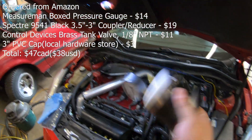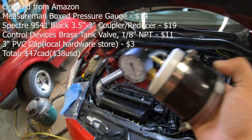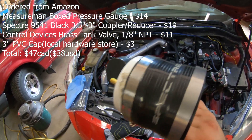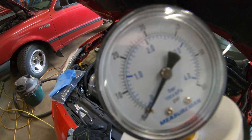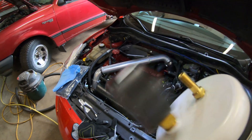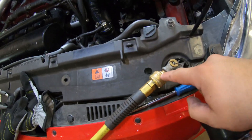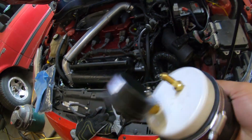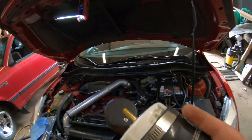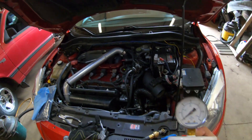I have my own homemade boost leak tester. I'll put the parts list in the description. This cost about $30 to make. It's a 3-inch to 3.5-inch coupler — a cheapy off Amazon for about $15. The gauge is a standard boost gauge, nothing special, about $10 off Amazon, and it seems accurate. Then there's a Schrader valve — you can also use a compressor fitting that goes direct to the compressor line, which would be better, but I went with the Schrader valve. It's more annoying because you have to hold the piece on while filling it with air, but it still works. The coupler even came with hose clamps. You drill your holes, fire them through, use JB Weld underneath to seal it up, and that's it.